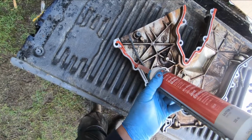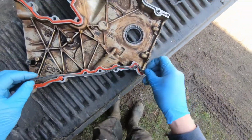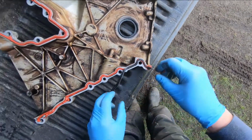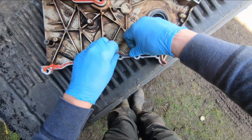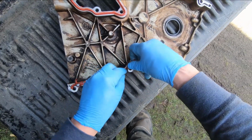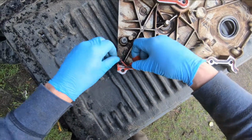Then you can see I've already laid out the gasket, and we'll set it in there and bring that around. See that? I want to make sure I don't turn the gasket over putting it in, because it's not used to having a bit of silicone down in the groove there, so it might try to turn over. So down it goes, like so. Looking good. I probably went a little heavy on the silicone, actually.